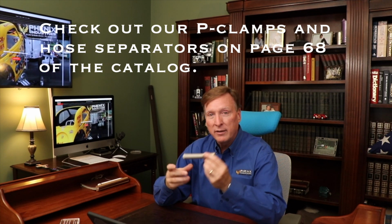So anyway, 100 series hose. All you do is add a number on the end of your dash number. If you want -16, it's a 116. So K116, K104, K106, 8, 12, 10, all of them, that's how you determine your size on our basic racing hose. On the 100 series hose, we have 2 types of hose ends that you can use.